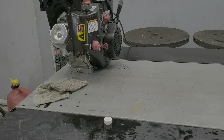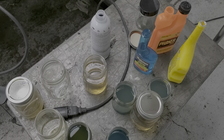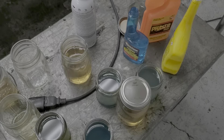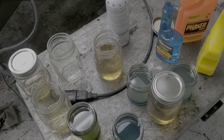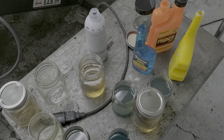Besides everything rattling all over the place and nearly off the table, it just shows you that most of the fuel treatments we tried just don't work. There's no reason to use them — they're a waste of money. So next time, maybe just use ethanol-free or use canned fuel. Better yet, switch out your gas very often and that will keep you from having these issues. This can be fixed, but at five times the rate with the Phaser, that's going to be more expensive than going and getting some top quality gasoline any day. Thanks for watching — like and subscribe.